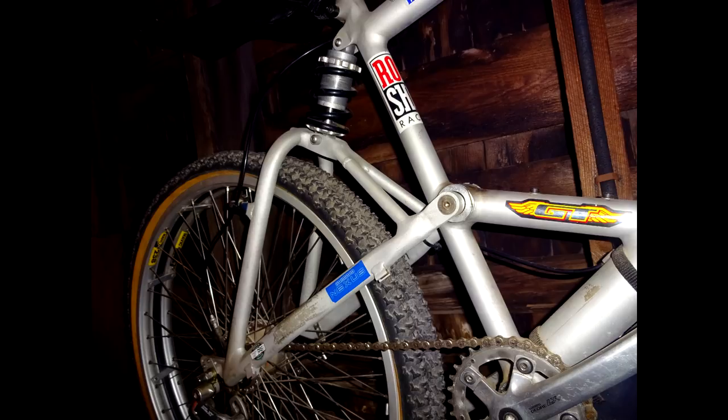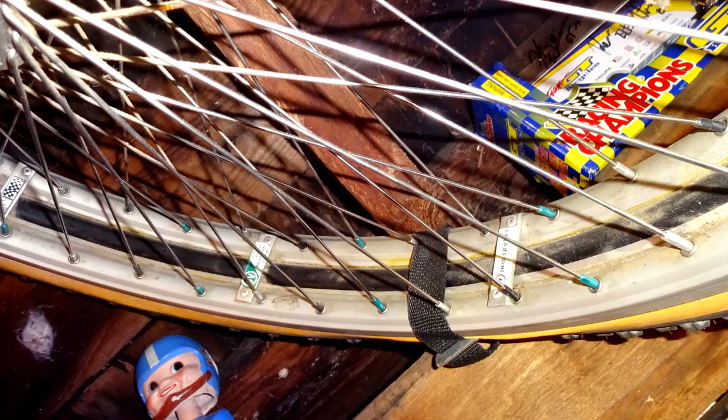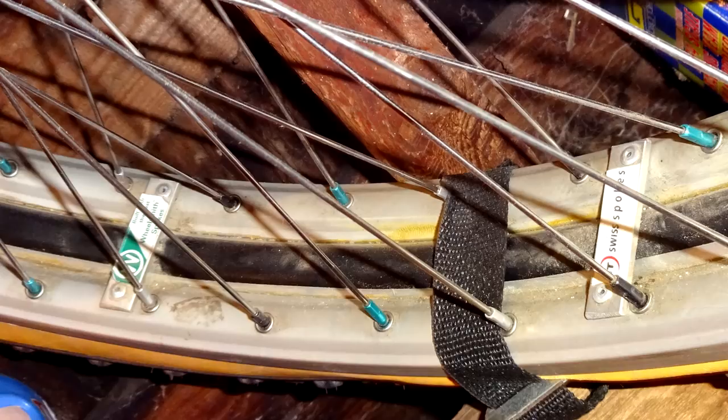The heart of this bike is these double wide wheels and tires. To build them, he couldn't just place two rims side by side because the tires would be crammed against each other — there wouldn't be enough room. So he had to take a third rim and sandwich it between the two outer rims that would mount the tires. He used glue to hold that middle rim in place, and also added little braces mounted into the two outer rims, held in place using pop rivets.